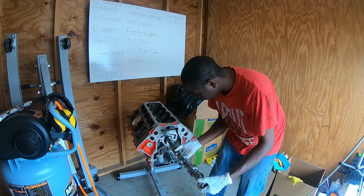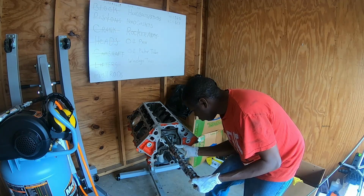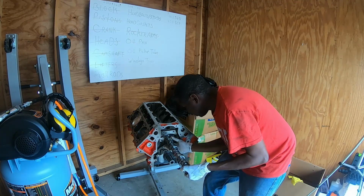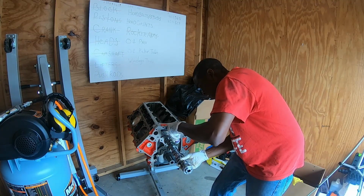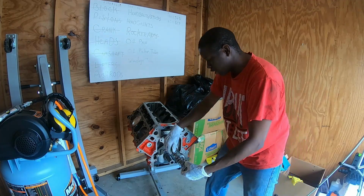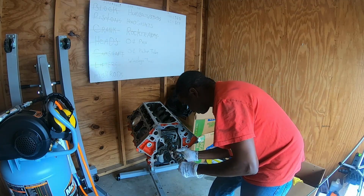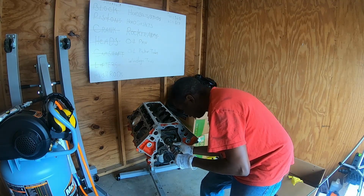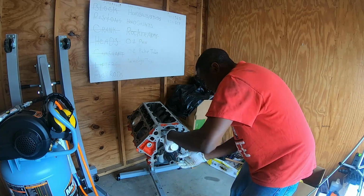This is the front side, and you just kind of push it down through there. Now you want to be careful to not ding up your bearings or your lobes on your camshaft. The first few inches are pretty easy. Slides right in. I already got some assembly lube on that one. Get some more lube on these. And this stuff is really tacky. It doesn't just drip off. So the stuff that I put down inside the engine already is still going to be there. Go on to the next one. Hits a little bit. And on to the next one.